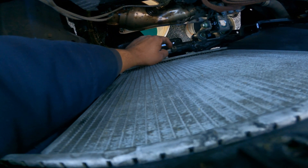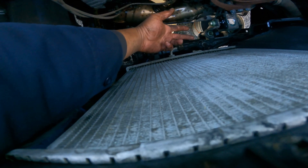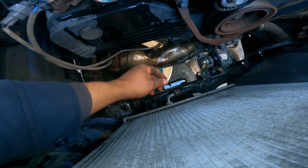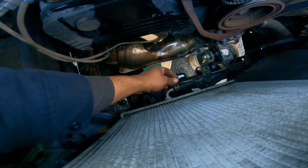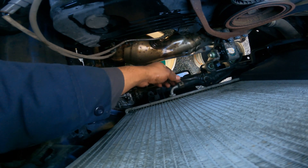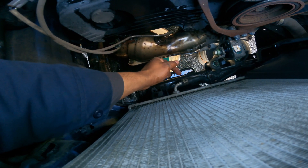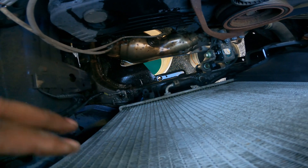You might want to have a bolt handy, or if you have one of those plastic crimping hose pliers — which unfortunately I do not have — you could just clamp one of these lines and take this off without losing fluid. But if you're unprepared, you're just gonna have to squeeze this with a pair of pliers, slide it down, and then as soon as you take this off you'll lose a minimal amount of fluid. Put a bolt into the line to stop it up.